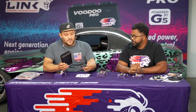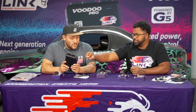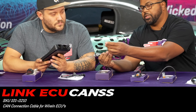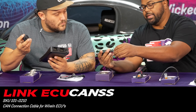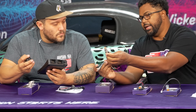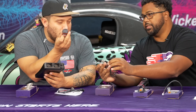How neat is that! So that would take care of one of your CAN connections on that ECU, but you also have a second CAN connection on the B connector on that ECU. So, in the plug right here? Yes. So for that one, we could use this one that already has the terminals crimped on to go into that SuperSeal connector, and then it has the flying leads for the power and ground and converts over to a DTM 4 as well. So those pins go just straight into this connector here? Slide right into it. That's pretty good.